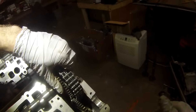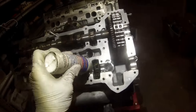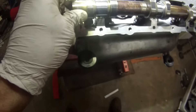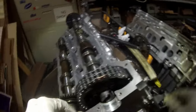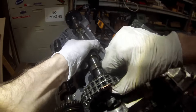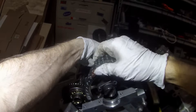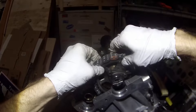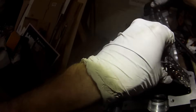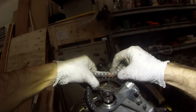The other big difference between the right and left sides is that the right side at top dead center has open valves, which means you need to push against the valve springs in order to get the cams in place, which can be a little bit difficult. The left side, on the other hand, all of those valves are closed, so the lobes aren't under any sort of pressure. So we'll start on the right side here. We're going to get the cams lined up and line the timing chain's colored link up with the timing mark on the sprocket. It's a good reference point just to visually make sure that everything's where it needs to be.